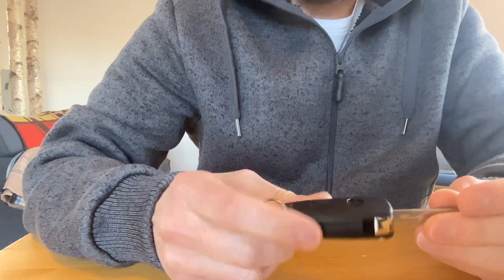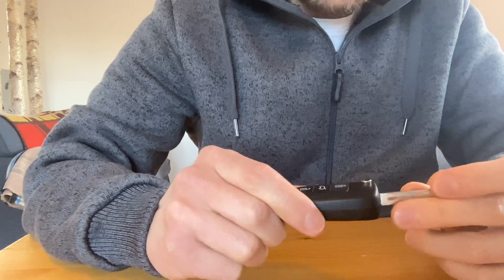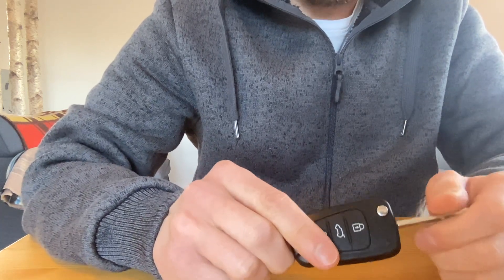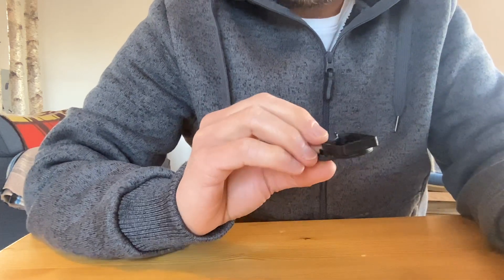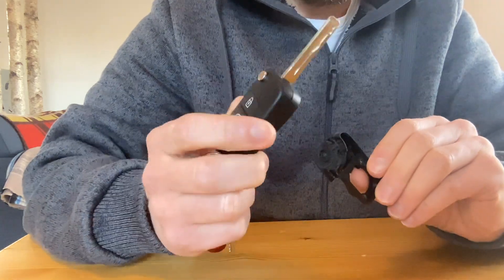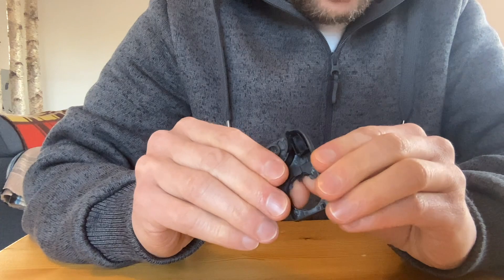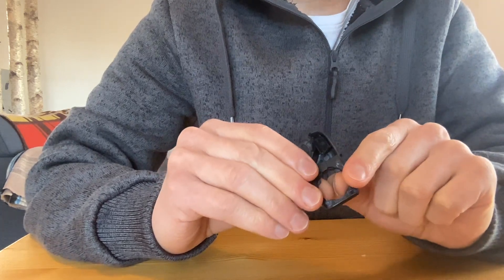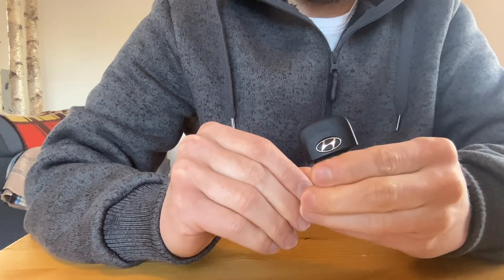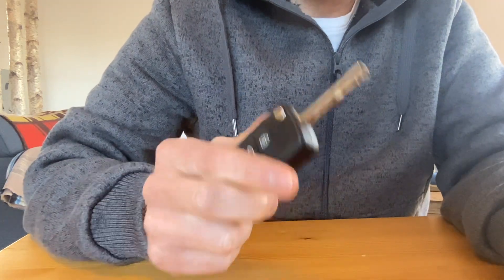Just one more little piece of information. This is a key from Amazon, and you can replace the key with one that you've cut. It'll fit in the ignition and it'll turn and unlock the steering wheel, but it won't actually start the car. I still happen to have the old key that I'm replacing because it got run over — that's why I'm doing this whole process. What you need to bring over from the old body into the new body is not only the circuit board that the battery fits into — that's obvious — but inside that little compartment there's a tiny chip, and that chip mates up with the security feature inside my Hyundai, or in your car. That allows whatever fob you have to actually start the car. So if your car's not starting, that's why.